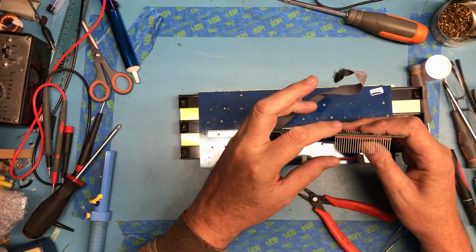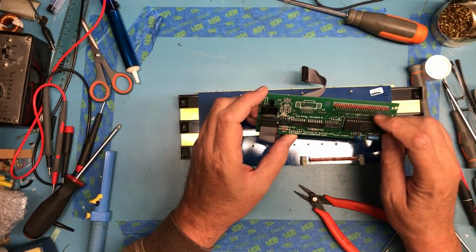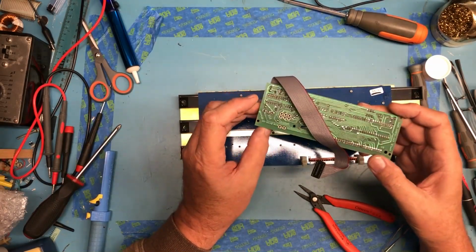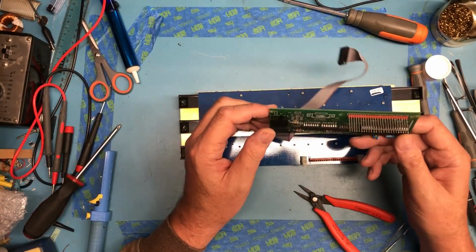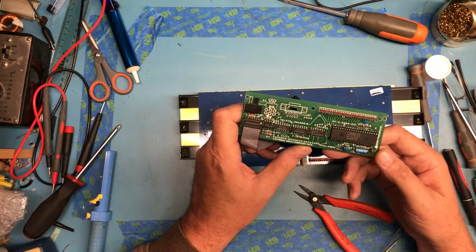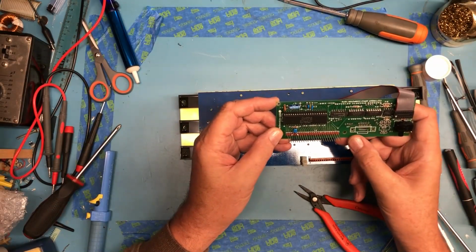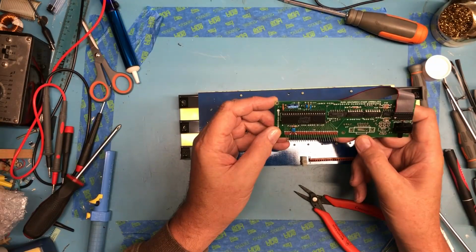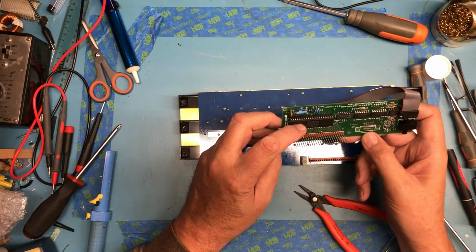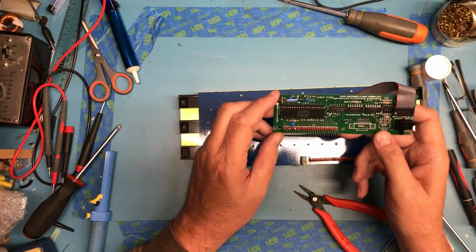So it's got this long set of pins here that push down through this connector. It's got a bodge cap connected there. That's interesting. The switch here that either reset or control reset to start the machine. Copyright 1979. I think this is all well-known stuff out there. That's interesting. Is that meant to be like a STB190 for serial from the keyboard? The chip, of course, is labeled by Apple. I don't remember what the encoder is. I remember seeing the part number someplace.